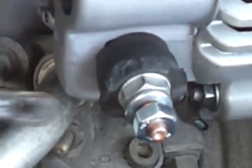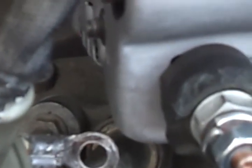What they did is they gave me a lock washer. I don't like to use it because it'll just tighten down on its own. If you want to use it, you can use it just so it doesn't back off. If you tighten it down good, then you can check it every once in a while and make sure that it's not coming loose.